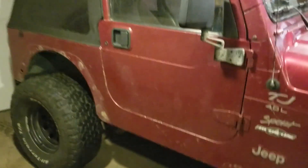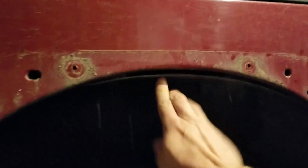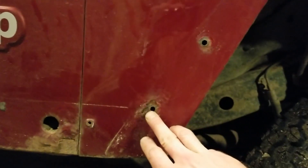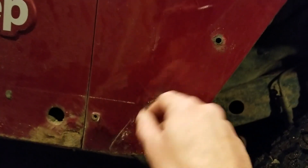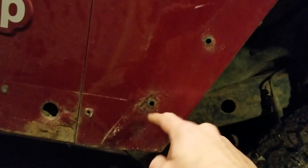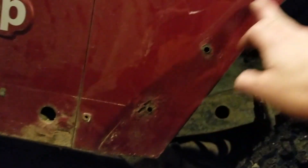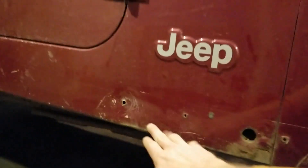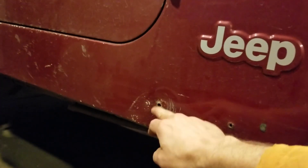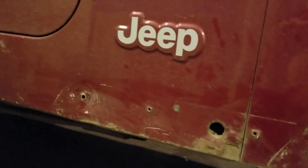Old flares are all off now. The other thing I wanted to show you: when you get to the back, I had this fender liner. If yours is all mushed and messed up like mine — or maybe even if it's not — you should be able to just push it out of the way. It doesn't really bolt to anything up here; it's kind of just in there. So you can push it over and get to those plastic nuts at the back. On an older Jeep like mine the nutserts are going to be rusty, and they might just spin in the hole when you go to take the bolt out. I ended up having to pull them out. If you pull them out and the metal gets a little mushroomed out, just take a little hammer and tap it in. This sheet metal here is really thin and bends easy. If you're careful with the hammer it won't matter — just throw some paint over after so it doesn't rust. I'll show you how to put those nutserts in in a second.